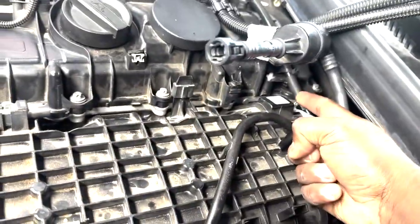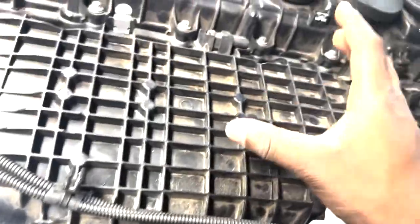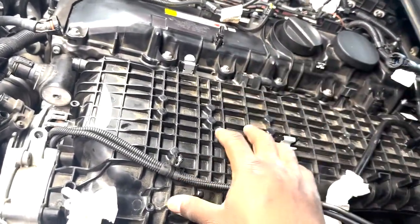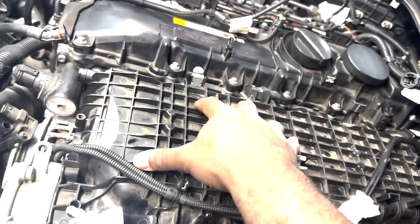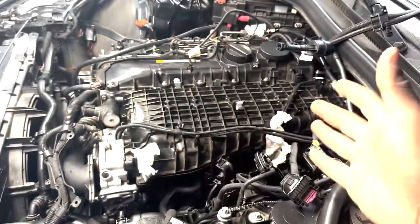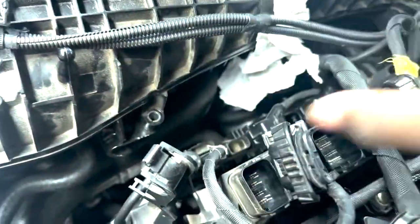And then the last one down over here is 7. For the joining torque, you're going to torque it down first to 5 Newton meters. Then after that, it's going to be 10. So the final torque spec should be 10 Newton meters for the intake bolts. The stabilizer bars, these are 10 Newton meters for torquing.